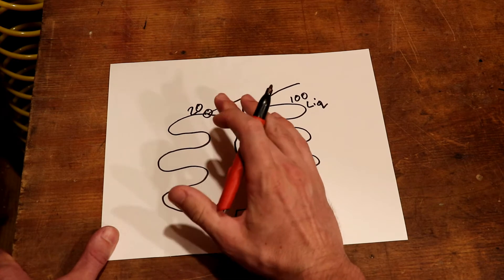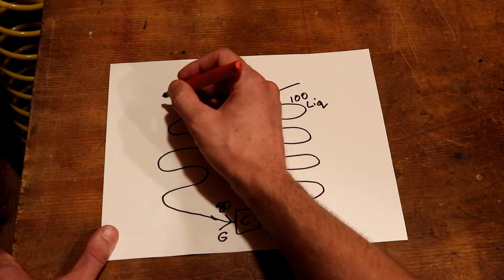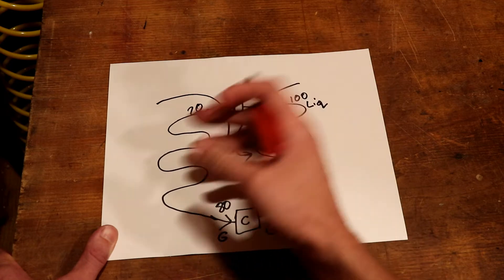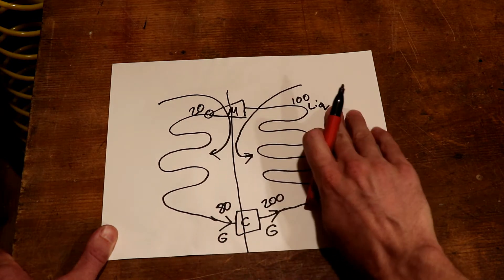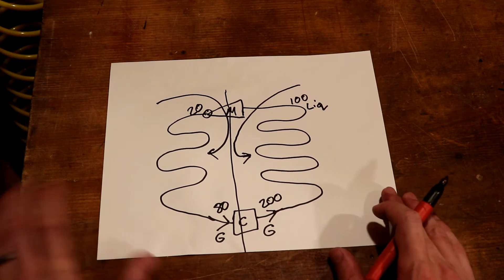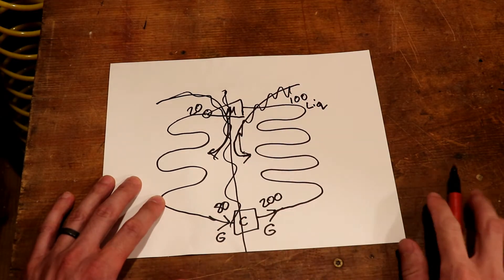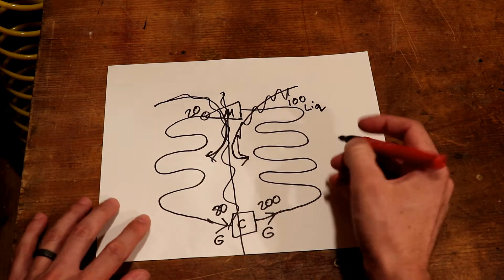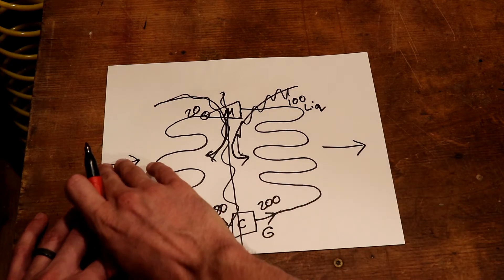Now we really have the cool effect that we need. In a window air conditioner unit, it sucks room air in and blows that room temperature air across the coils, cooling down that air and in effect cooling down the room. These two systems are divided — there's an outside coil and an inside coil. But if we think about how this works in the case of a dehumidifier, those separate fans are gone, that division is gone, and these two coils are in fact right beside each other. There's a fan pulling air through and it sucks air across both coils at once.